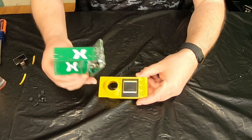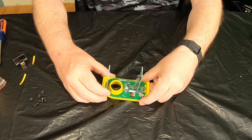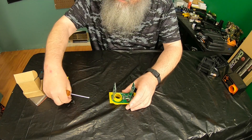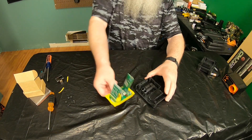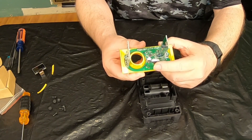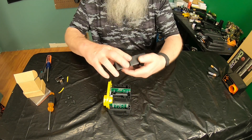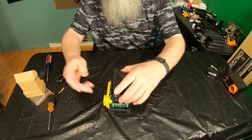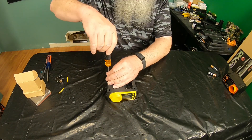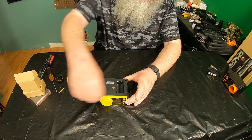All you have to do is take your circuit board, slide it into the side without the tabs, and then push it down into the tabs — it slides right back into place. Next, put your two Phillips screws back in to hold the circuit board in place. You'll see two holes for the batteries, and on the circuit board you have two springs — just match up the circuit board with the two holes for the batteries into the springs. Then put the top back on, put your four screws back in, put your legs back in, and insert your batteries.